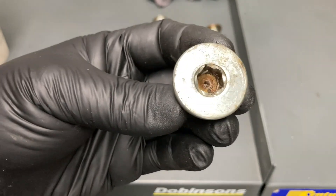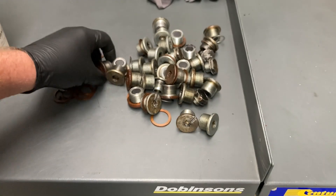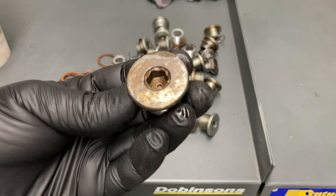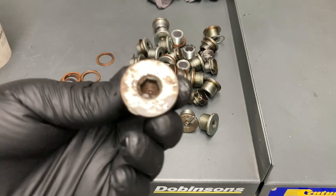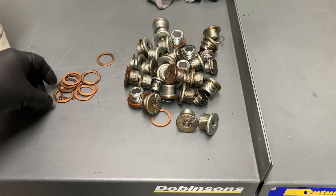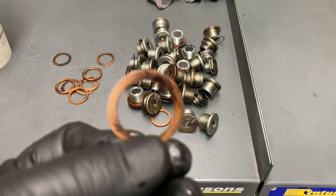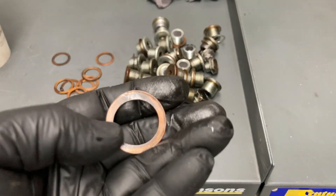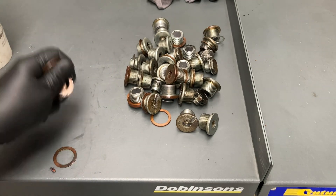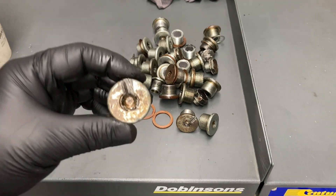Let's sort through them — some of the ones that look alright, we'll keep. That one's knackered as well — you think I'm going to risk it? No way, mate. If you didn't over-tighten it, it's probably alright. Look at that one — that's like a 12mm rusted out, that's ridiculous. That one's rubbish as well, been chiselled out — look how round that is. This one doesn't look too bad, but in my book: rubbish. All these copper washers — you're doing your diff oil once every 40,000 Ks. You can either replace it or reuse them a couple of times if you want.